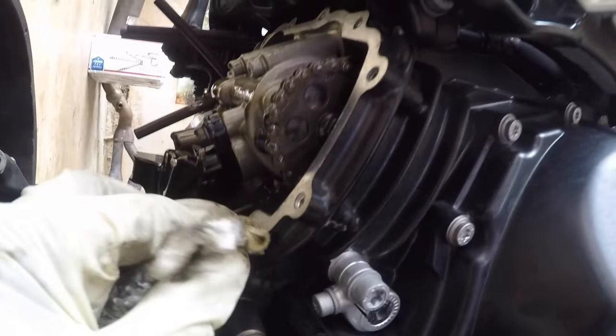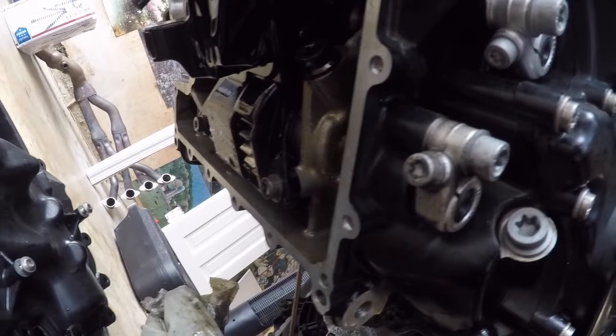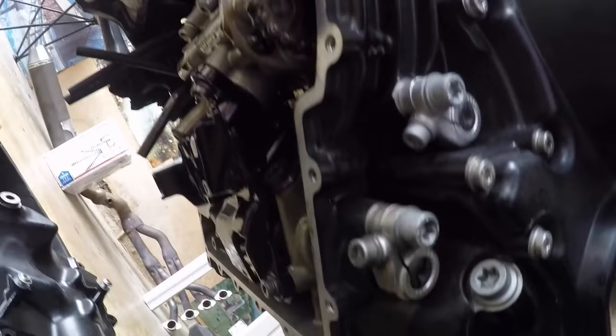When I get back, I'm going to show you how we're going to put the oil pan back on. But first I have to order more sealant. I'm going to use Yamabond 4 by Yamaha — that's the sealant I like to use on engine cases. I've had good luck with it, it hasn't leaked, and it has great reviews. Other people like to use the Honda bond. If you've never seen inside the bottom of your engine where the oil pickup and oil strainer is, this is it — this is what it looks like. I'm going to clean up the oil pan, order this sealant, and then we're going to button it up. That will be our next segment.